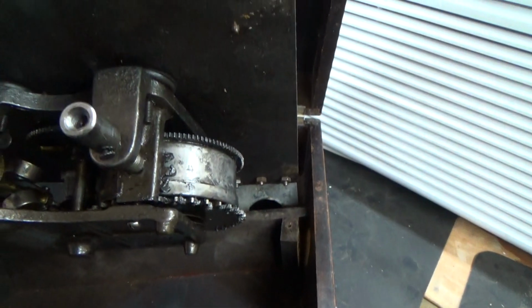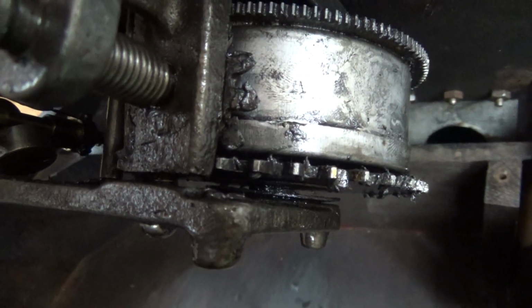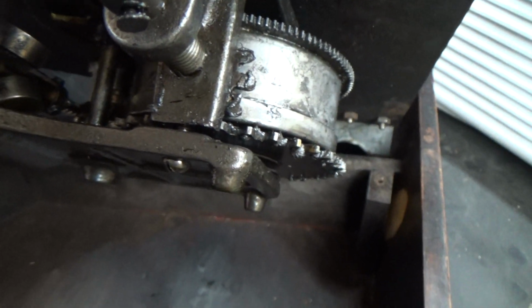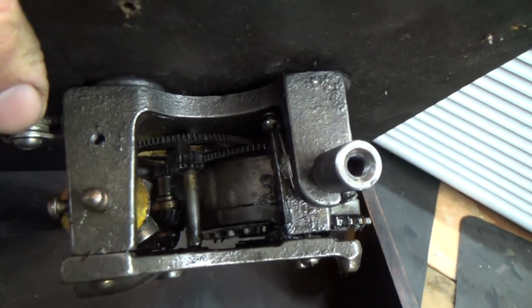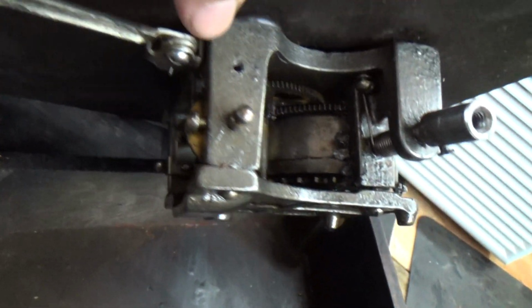It has issues. I can see that already even without taking it apart. For one thing, either someone tried to take it apart themselves before and didn't put it back together right. You can see that screw is half out. I already know the spring is broken. Single spring in this. Fairly decent, robust motor for a phonograph this size. And nothing that can't be fixed.